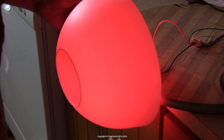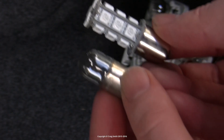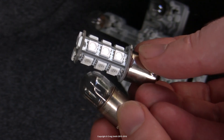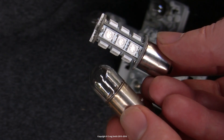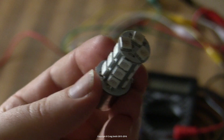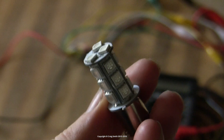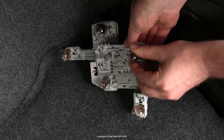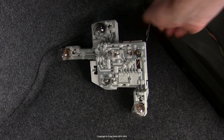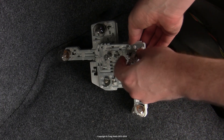You need to think about the enclosure and reflector housing that the original bulb was in and what kind of LED arrangement would be best suited to replicate the original filament. We also need to think about the size of the LED, because LED replacement bulbs are typically much larger than the original filament type and we need to be careful that we don't get something that's too big and simply won't fit. In this case this bulb meets both those requirements so should be suitable. To replace the bulbs we simply remove the old ones and insert new ones, then turn the side lights on and check that the tail light LEDs are working.